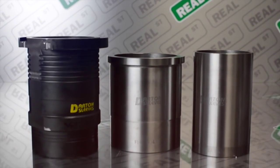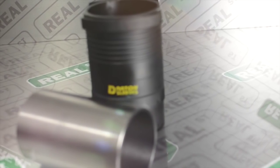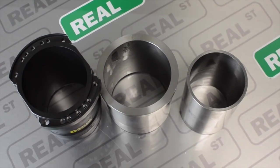In the realm of power level, the factory was considering the best balance between heat mitigation and cylinder sealing. They weren't really considered about what happened to the engine when you doubled or tripled the power level. An aftermarket sleeve is a thicker build of material, and the alloy lends itself to keeping shape under elevated combustion. So as you raise the power level with an aftermarket sleeve, the cylinder will stay round, and when you raise the power level with a factory sleeve, the cylinder can distort or crack.